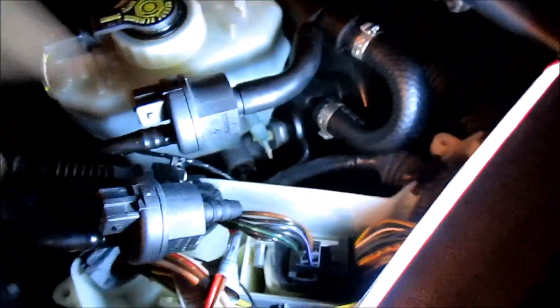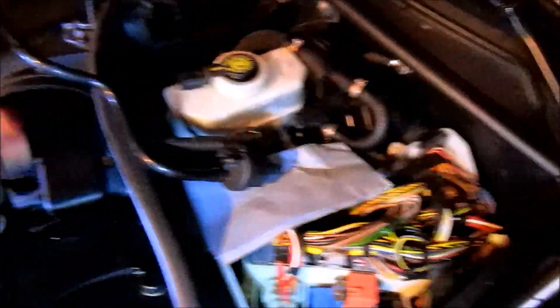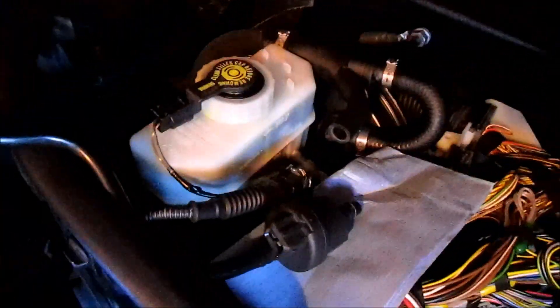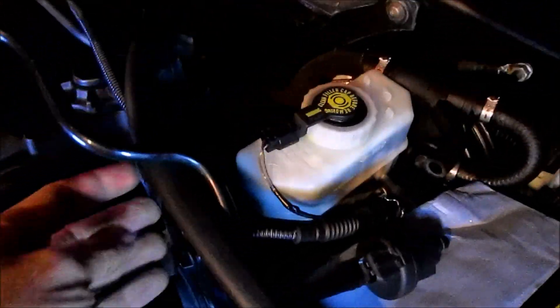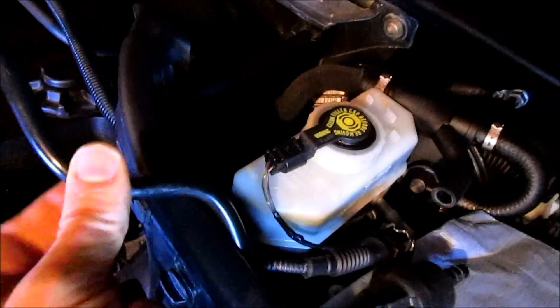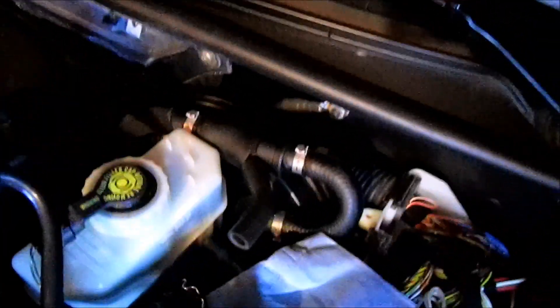This will get snaked back through that hole and go back onto the top of the new carbon airbox. So we're going to remove this from that piece — the stock piece was pretty easy to remove, actually. The key to success is to pull it out from beneath the firewall piece, pick this rubber piece up, push it out, and slide it through so it's no longer in between.